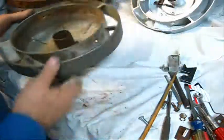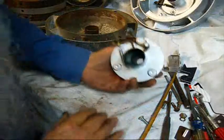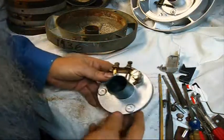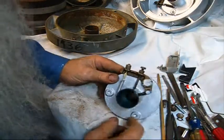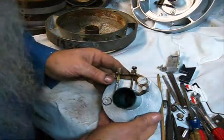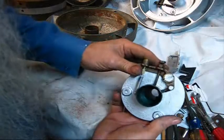The subject of this lesson is the governor — the governor setting is kind of on its own. You will read in some publications that there is a measurement here. I've never seen that measurement in anything Maytag produced, but I have found that on engines that I build and run myself, I prefer a little bit more movement than what you see right there.